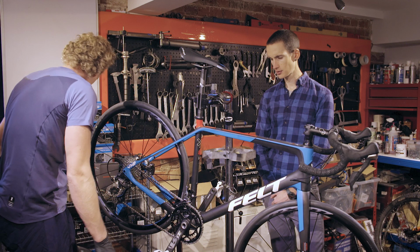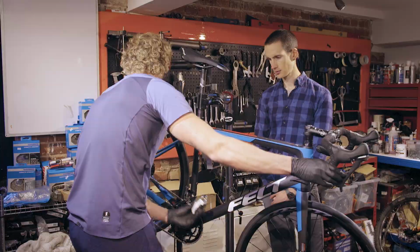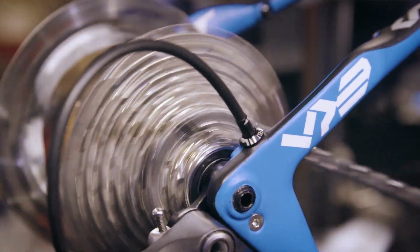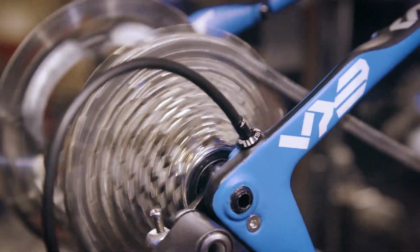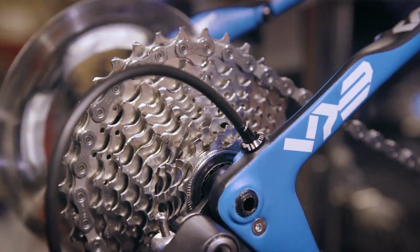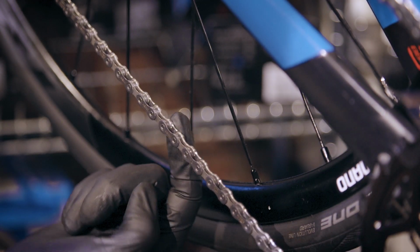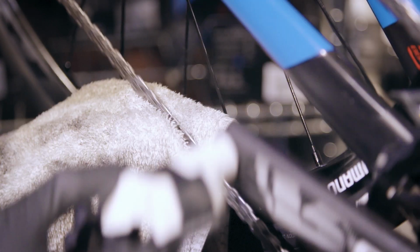And then once you've done that, so that we apply the lubricant to all the chain rings, we're just going to shift quickly through the bike gears itself, giving the chain enough time to run on each cog to make sure there's lube on those. Once I've taken the chain around all of the cogs, I can then gently grip the inside and the outside, so these are the face plates of the chain, just to take off any excess lubricant.